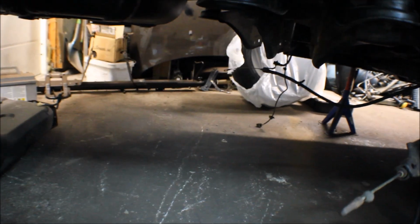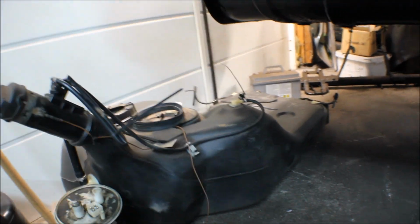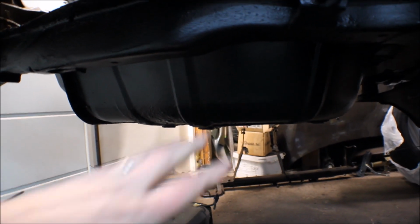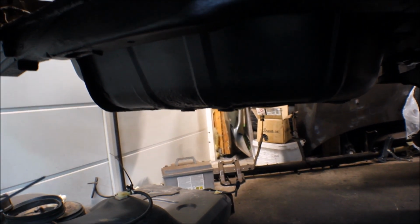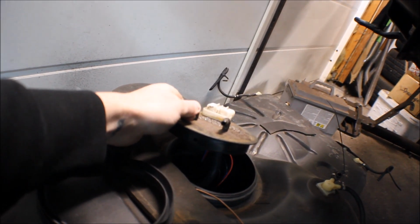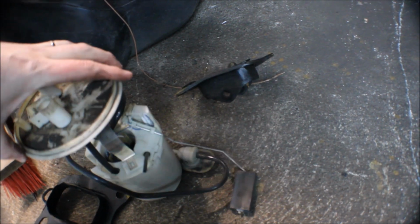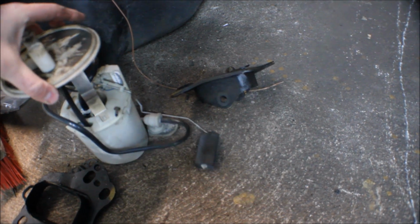And then we have come to the last part, and that is the fuel tank. This is also from an Opel Omega, and as you can see, it has the cutout for the rear spare wheel barrel, or what you call it. We will make this fit, and this filler cap actually goes up and sits perfect where the stock one is. I will try to get this fuel pump out and reuse the Saab original and just extend the connectors and everything, because here we have the level indicator of the fuel. I want everything to work with the fuel gauge inside of the car later on.